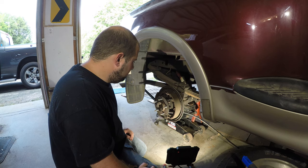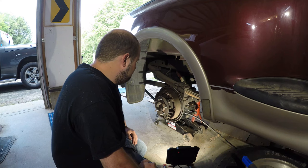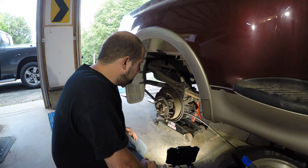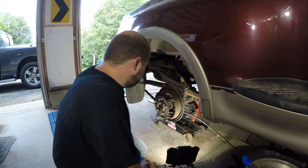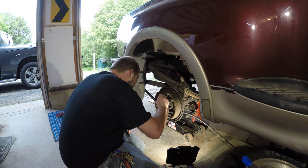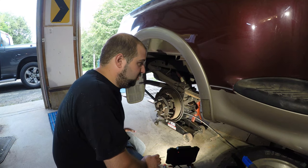After a little bit of delay, I decided to order new rear brakes for the truck while we're going to have to take this all apart to get the emergency brake cable out anyway. So we're back taking this apart — this is the driver's side. First thing I do on drum brakes is I'll take a lot of pictures of how it's put together so that I have something to look at when I go to put it back together. One thing when you're in here — look at your wheel cylinders and pull the boot back a little bit and see if they're leaking. This one doesn't look too bad but I have a new one, so we'll see. The brake job itself is probably going to be a separate video — we're just going to focus on the emergency brake cable in this particular video.